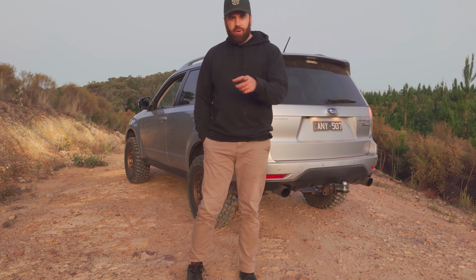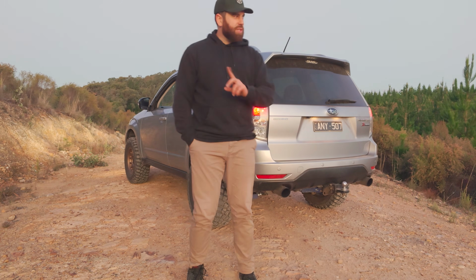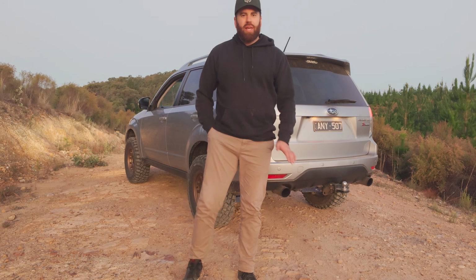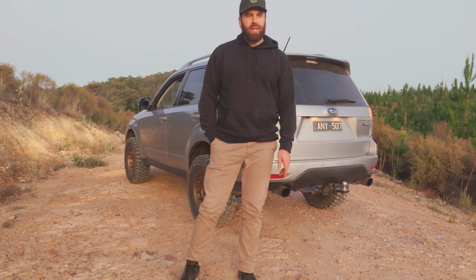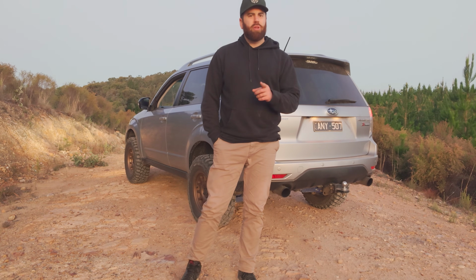There is a little knocking noise from my front end after this, but I think it's just a sway bar bush, which is interesting because I just replaced those. But I just had a look under there and it is dislodged, so not sure what happened there. It might be broken already, even though I just put brand new ones in and they were genuine ones. But yeah, I'll have a little look and fix that.